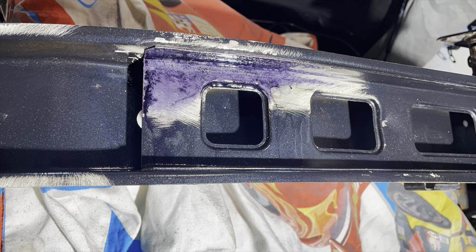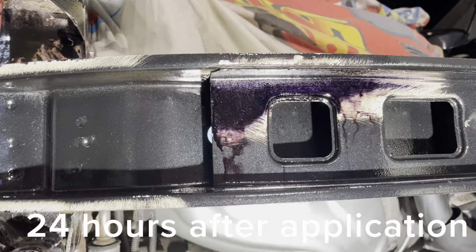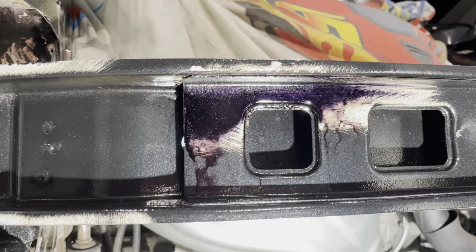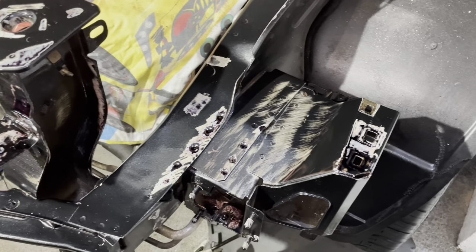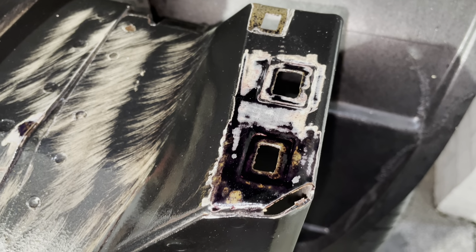The product only works at temperatures above 10 degrees and must be allowed to fully dry. Guidelines stipulate at standard atmospheric conditions, 15 degrees and a humidity of 60%, the average drying time is 24 hours. Sometimes multiple coats must be applied before corrosion is fully converted into a deep black colour, providing indication that the area has been treated. When applying multiple coats, you must make sure that the earlier coating is completely dry.